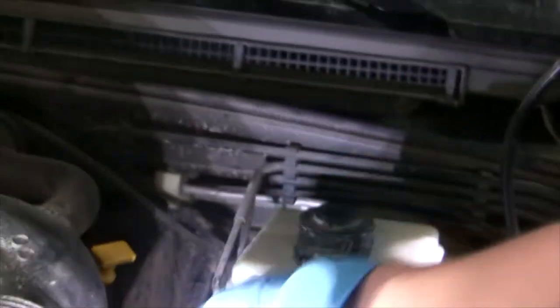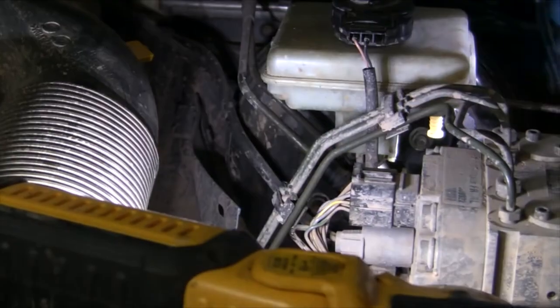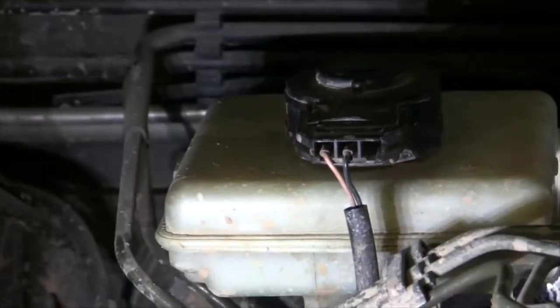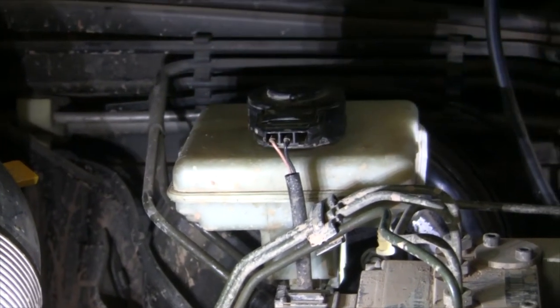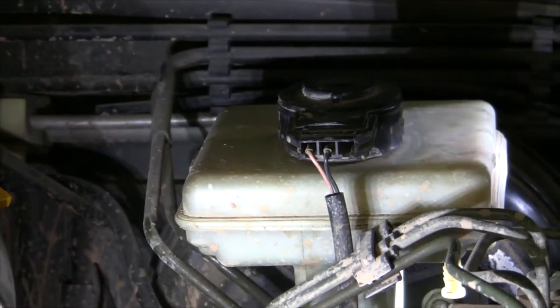There are two rubber grommets and those rubber grommets start to fail. In my case they fail when it's cold and I lose a considerable amount of fluid in the winter. It's springtime and I've wiped it off, and for about the past two months I haven't had anything leaking — I've maintained a good seal. But I've got a spare anyway and now's a good time to swap that out.